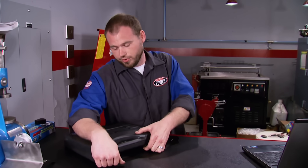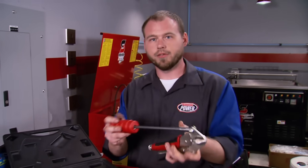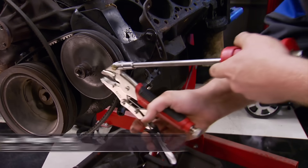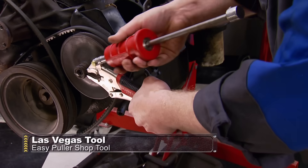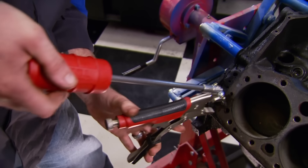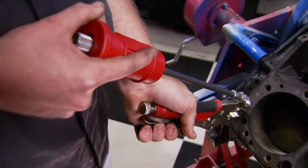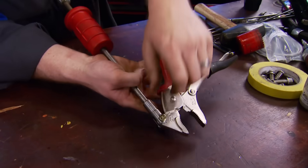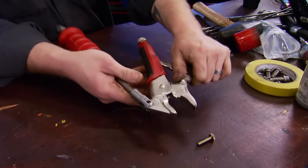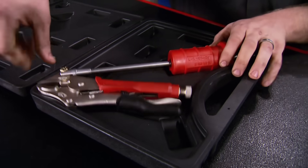We all love cool new tools at the shop, especially one with as many uses as this Easy Puller from LasVegasTools.com. You can easily pull everything from seals to broken bits — even a homemade cotter pin. Just clamp the locking pliers onto the item, slide the two-pound hammer quickly along the slide bolt to the end, creating a powerful pulling force. Remove the quarter-inch bolts at the upper jaw along with the slide handle assembly, and you've got a traditional set of locking pliers. It comes in a protective carrying case and sells for about $39.95.